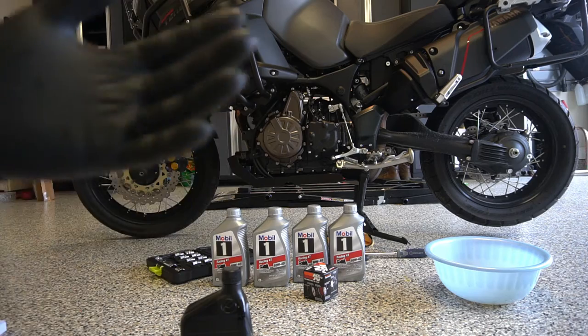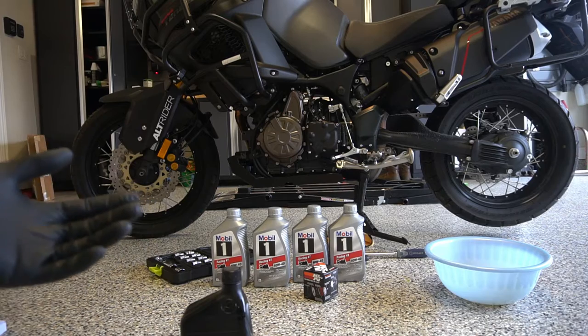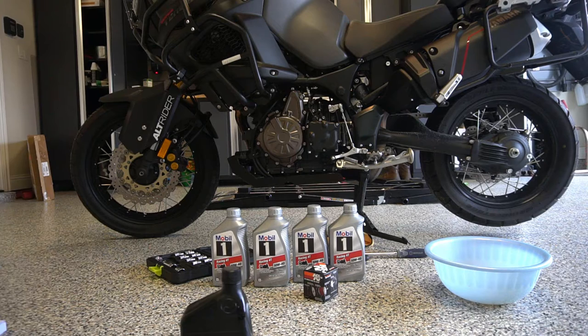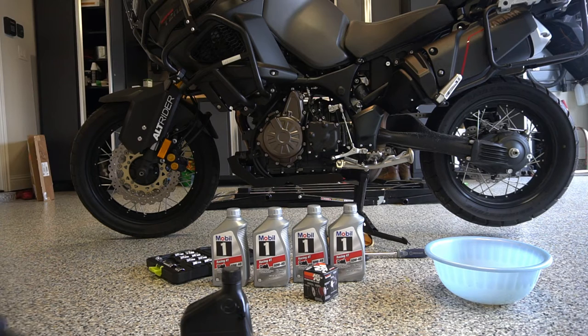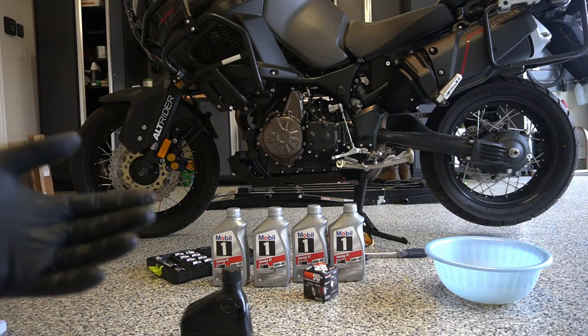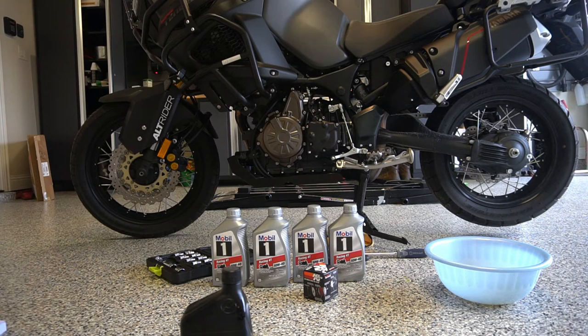The Camaro is a sports car version of GM Performance, and so it goes with the Camaros, the CTS-Vs. If you put limited slip differential fluid like Royal Purple in those vehicles, it actually causes a big issue in those cars. A lot of people say they take it to the track and then they complain of excessive vibration in their differentials, and it's not really because of that. It's really more because the additive in it is not in the correct proportion. So if you go and read, a lot of those guys just go back with the original AC Delco transmission fluid because GM had put the correct amount of additives in it to fit their transmission.